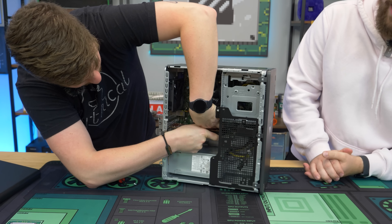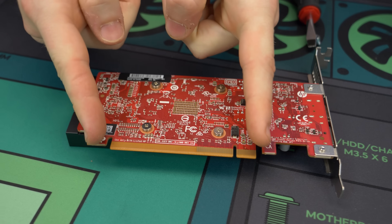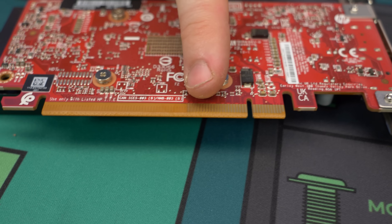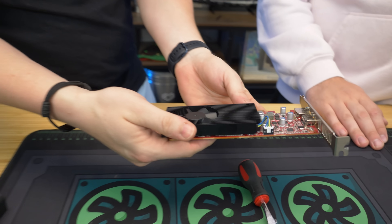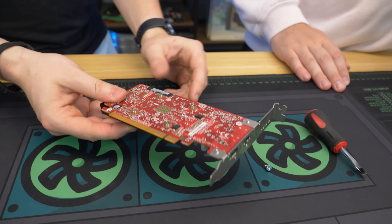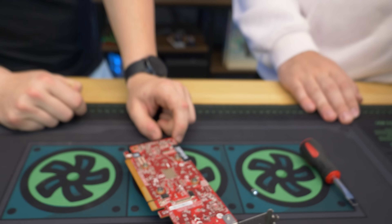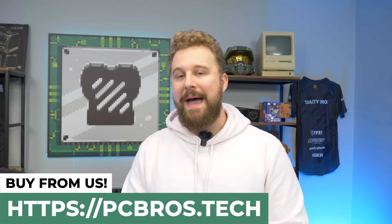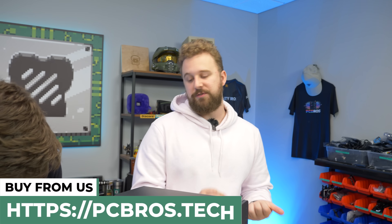That is going to hold us back a bit — we're wondering how bad it actually is. This is an X16 physical lane, but the actual pins only go partway — that is what X4 means. If it went halfway, it'd be X8; if it went all the way, it's X16. It's weird seeing a 6400 in such an R7 240-looking card. We also notice there are no anti-tamper stickers, so the card could be refurbished. We do use these cards in Optiplexes over at PCbros.tech and the performance is still very good even in a Gen 3 system, so with a higher-end CPU like the 5600G we expect even better performance.